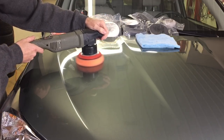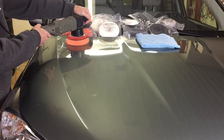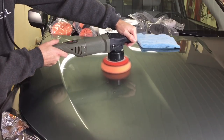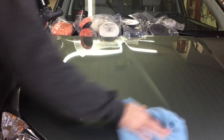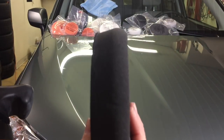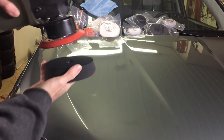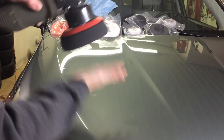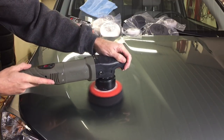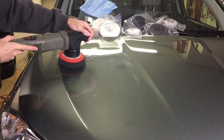Although this little polisher here is not forced rotation, you are able to take care of some medium to light blemishes or swirls by putting on the orange cutting pad. Remove any residue, switch over to the white polishing pad, then go to the black finishing pad, or apply a wax or sealant. Even this black finishing and application pad is a bit stiffer than others due to its thickness and the type of machine it's getting attached to. Use this step to achieve whatever clarity you're looking for — jewel it, whatever you want — then apply a wax or sealant and you're good to go.